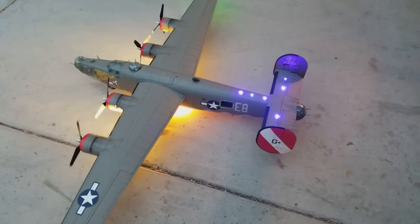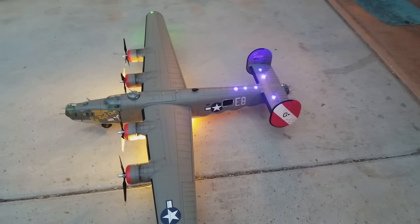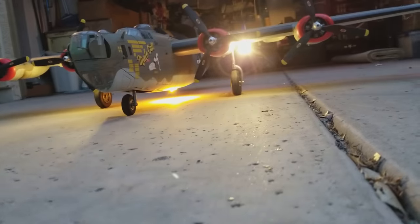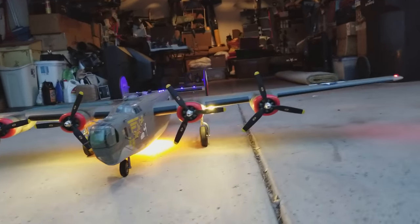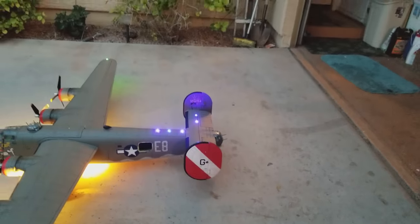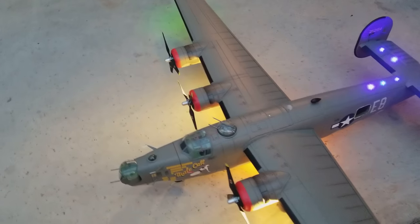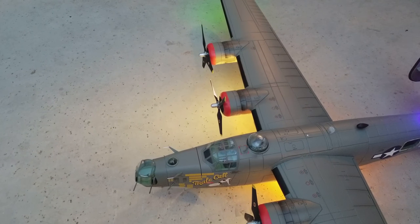Here's a little video with everything on, coming out here doing the first ground check. All the lights are on because I had to gear down — the seven formation lights and the IFF recognition lights are on on the bottom, and also the landing lights are on, as you'll see, with the top strobe and the strobe on the rudders, also the wing lights which are actually visible top and bottom — both red and green — and the 360-degree turret mixed with the nose.